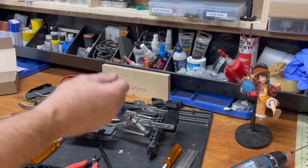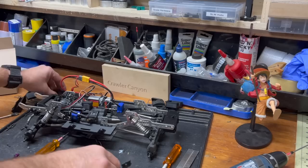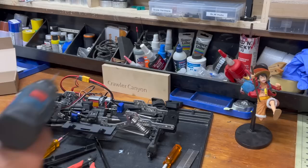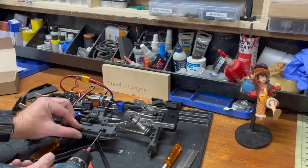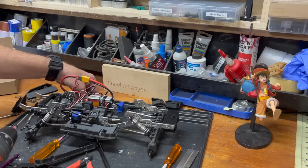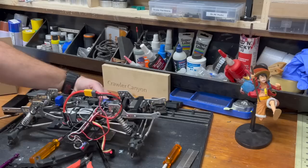I think I brought some screws over. Oh, as I've been going, I said that I wasn't going to go screw bin, right? Well, we threw that out the window. Because it reuses so few of the big cap heads, I just started omitting cap heads and replacing them with button heads. Stainless button heads, that way we're button head all the way around. I'll have a couple screws to chase down during the final cleanup and the final tighten down, the thing I have to do before we go out and wheel it.